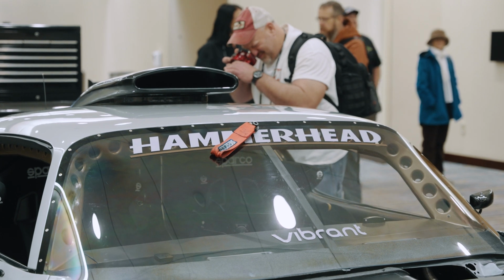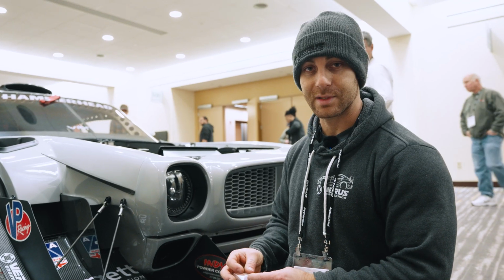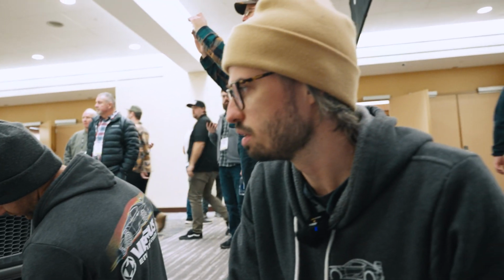We are putting some scanning dots on the car so that we can scan his new front wing setup, throw it into CFD and see what it's doing. Yeah, so we took the initial front splitter setup and made a few recommendations, and they made changes based on that, but they used different wing elements than we had initially used in the concept. So we want to scan what they've done compared to the concept we came up with and get a more realistic picture of where we're at.